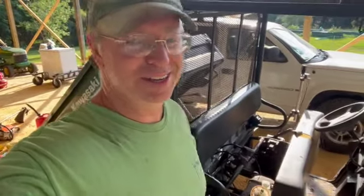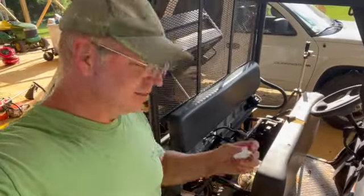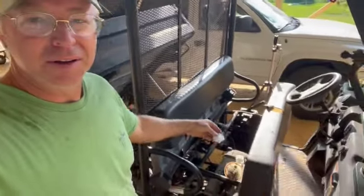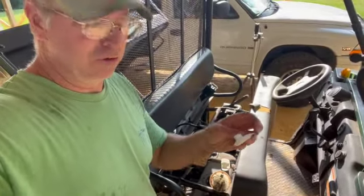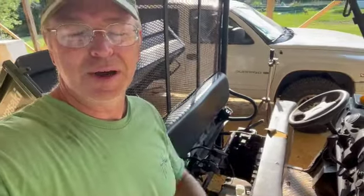Next is the fuel pump, because I know I'm not going to have any luck getting the bead off the tire — I've tried that for like two days and I can't get it, so I'll move on to the fuel pump. This is what the filter looks like; it goes at the bottom of the fuel pump assembly housing, then that little cup goes over it and the whole thing reassembles and goes down in there. This should stop debris from coming in.